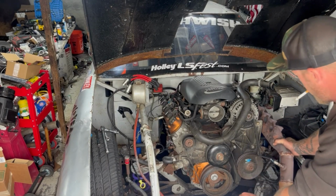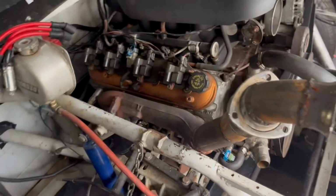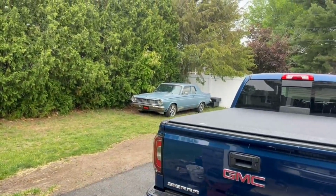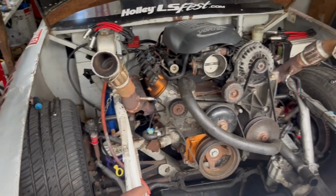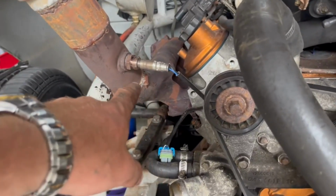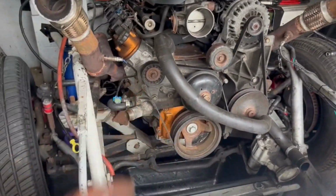I want to just flip them, but a power steering pump might pose a problem. Gotta get the other side off and figure it out. I wanted the driver's side to come, like, I got all this space, kind of like how I did it on the Dart. Instead of down and back stock manifolds, down and forwards. So the driver's side on the passenger side, but that one doesn't have power steering. So it was easy. So if I just flip them up, I can cut that off. Have to come down and then back up.